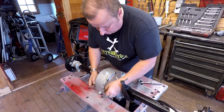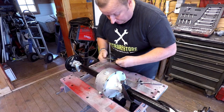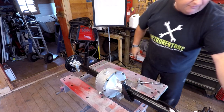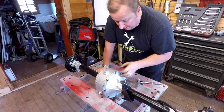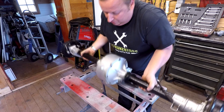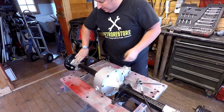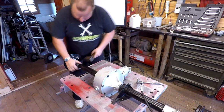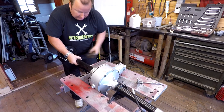Right, so I've undone all the nuts and bolts around the hub. I haven't taken the drive shafts out — I'm hoping I can just drift it apart for this section. Simple reason being I've got no one here to hold it, because the end nuts are very tight and it's really a two-person job. That's all the nuts out now, so I'm going to settle that back on there and just try drifting this back gently — hoping it will separate, which it has. There we go.